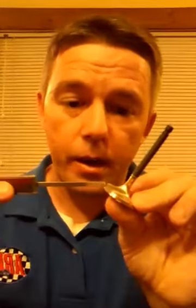And on the intake, you want it right out close to the edge and fairly thin. Another thing people debate all the time is a thick contact area versus a thin. I like a thin on the intake because that thin area is going to have more pressure on it because of the valve spring. That small area puts more pressure on the valve, helps seal it better, and plus you're less prone to get a foreign object hung in it.